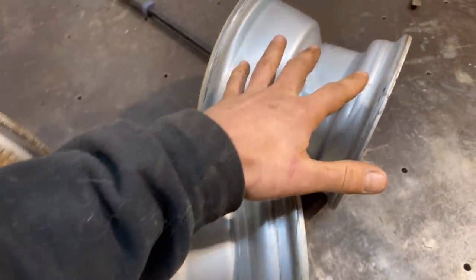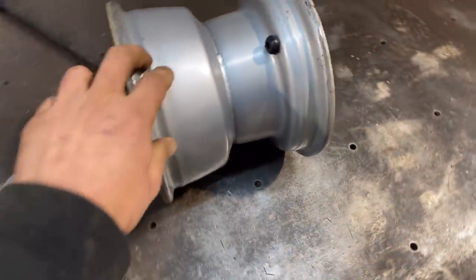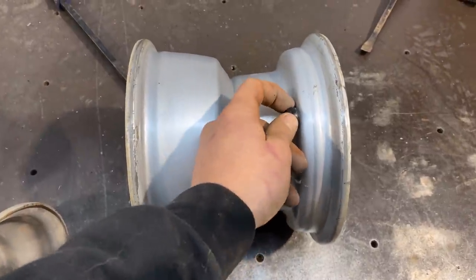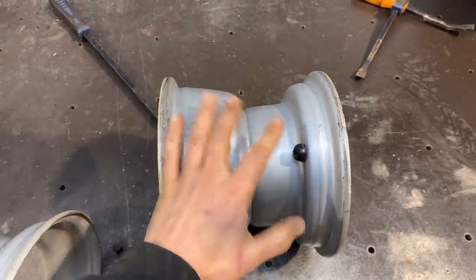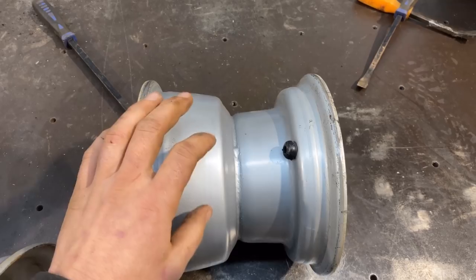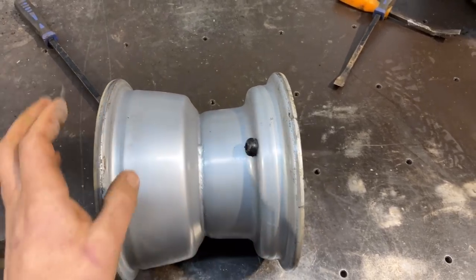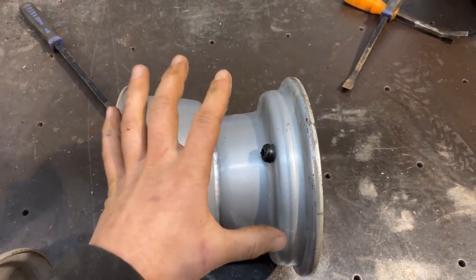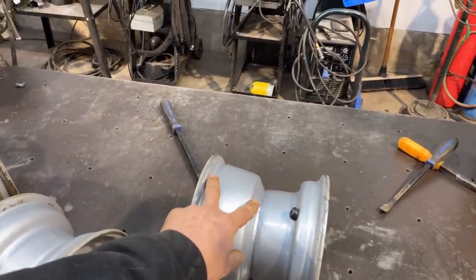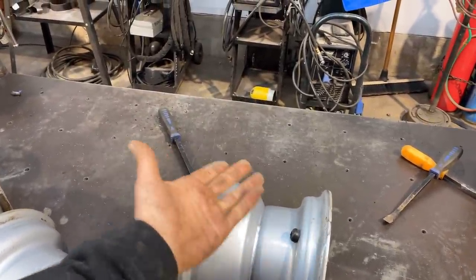And then for the rear rim, this is the back side of the rim. That's the front side. There's the air right there. The new tires are tube type, so they're not gonna be tubeless tires anymore. I'm not too worried about it. I'm just gonna pop these out, run tubes in them. So this one we're gonna have to suck up this way and take it like that. I'm not exactly sure how I'm gonna do that yet because these are all tapered. It's not like you can just take a little bit of a flat section out and put it back together.